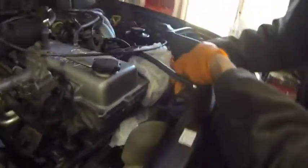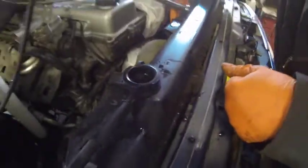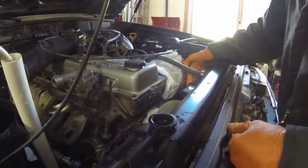You may want to cover up your distributor and your alternator with some bags so you don't get a bunch of water on it. It's pretty clean.